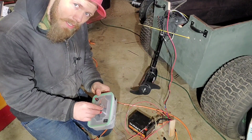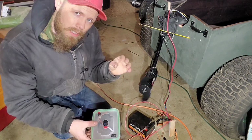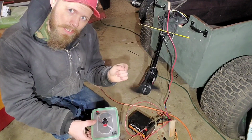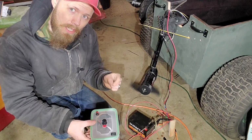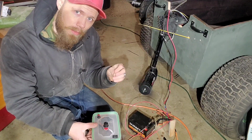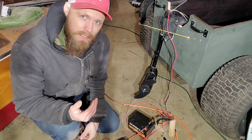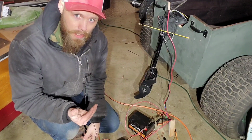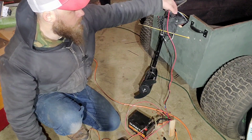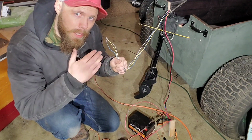So when you go faster, it's going on, off, one zero, one zero, just a little bit faster. And here too, it's going one zero, one zero, but even faster, all the way up to here when it's going really fast. The cool part about that is it's using less electricity and it's way smoother and it creates less heat, probably, inside of here than the method of using different amounts of resistance to throttle down full power.